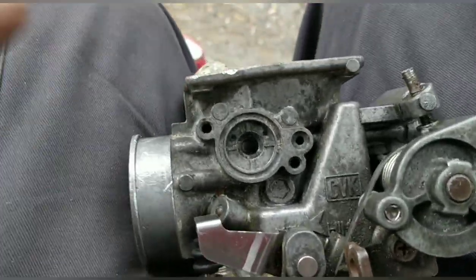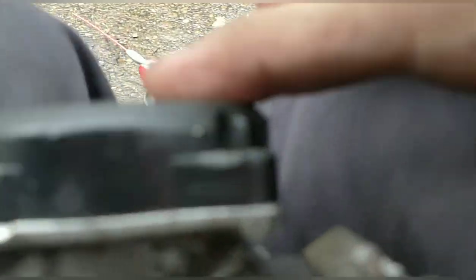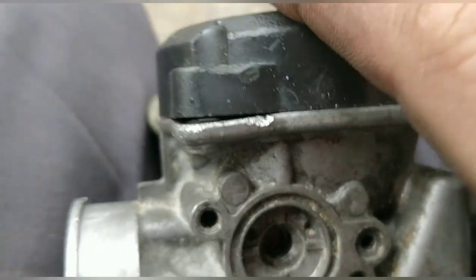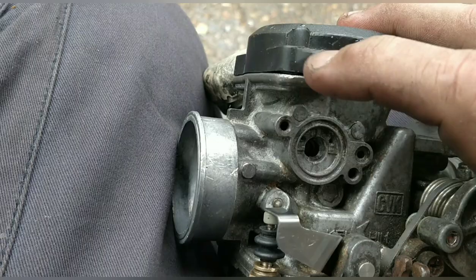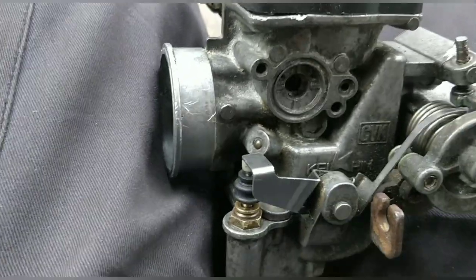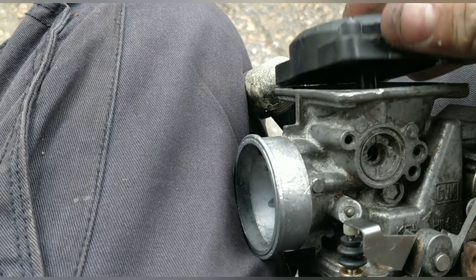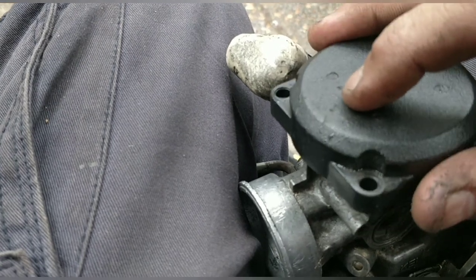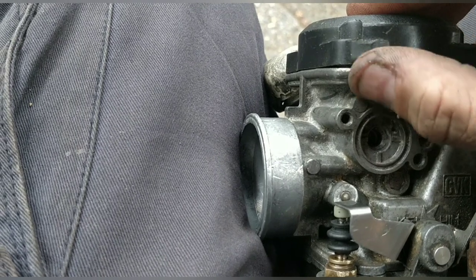I've noticed one other thing about this carb which makes it a dud. The lid's on and seated — look at this gap. This corner's been bent; it's the only corner doing that. So it's not good. Basically if you get air going through there, it ruins the whole vacuum system. This carb could be done — I might need to switch. It's bloody annoying. I'm going to try and tap that corner out a touch, because technically the seal is in there, but if air's getting in it's going to ruin it.